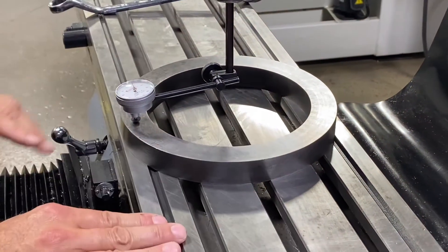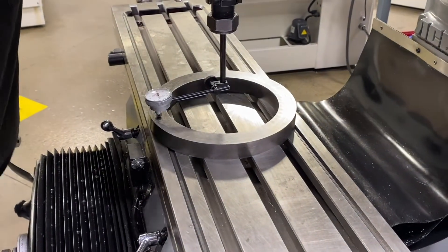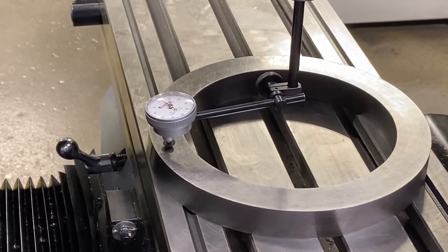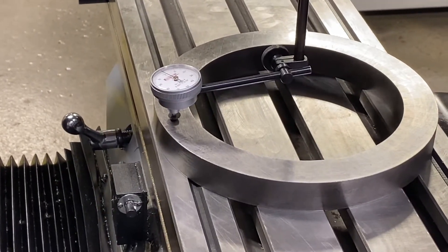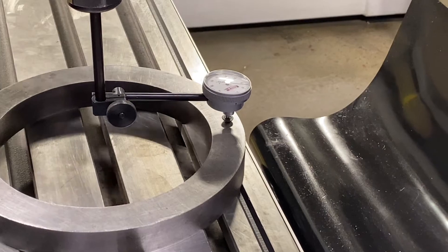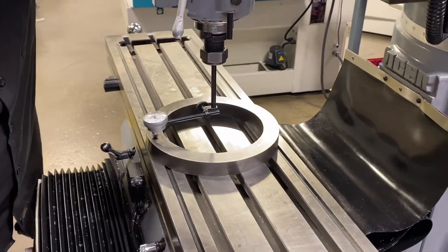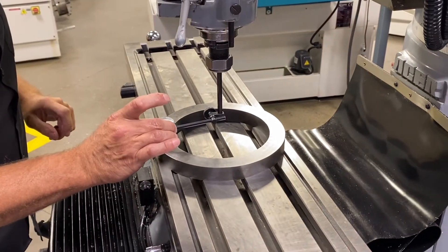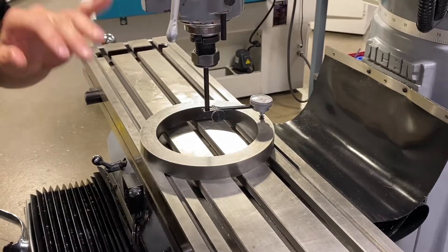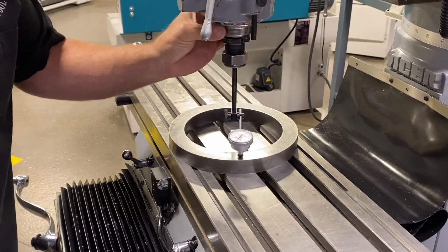Since I'm zero-zero left to right, if I bring the tilt to read zero on my indicator I should get fairly close. I'll rotate the pinion gear very carefully, bring that to zero, and sweep it towards the back side. That got me fairly close — I'm in the negative direction, approximately 12 thousandths. Same principle: I'll rotate it negative just a little bit, zero out, sweep it towards the back side, and it improved a little. Because the pivot points are different than the rotation, it'll be slightly different movement on the indicator. We're at negative 10 thousandths on the backside.